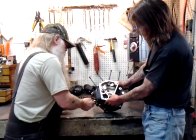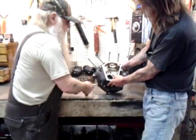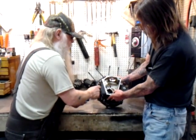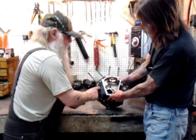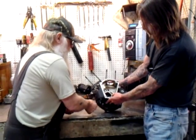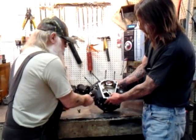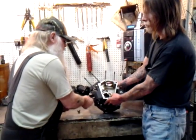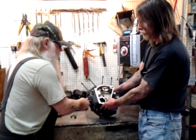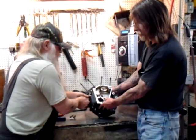If it is, that's something we'll just have to deal with. Four bolts here hold the outer cover, then you've got the inner pump itself. This is just a cover where your lines hook on, feed to. Then you've got drive gears which pump the oil, and you've got bigger gears — return gears — that pull the oil out. You always want to pull more oil out than you're putting in. That creates a scavenging effect, like slurping on the bottom of a straw when you get an empty bottle. That's what you want — you don't want it to ever be the other way, because the oil runs right out and it'll ruin the motor.